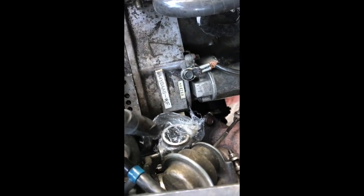So I've also blanked off the two turbo inlets just to make sure nothing can fall down there. It's just with a bit of plastic, and it should be fairly obvious. I need to remove those when it goes back together, but I don't fancy doing a swap out of a primary or secondary turbo because something disappears down the hole.